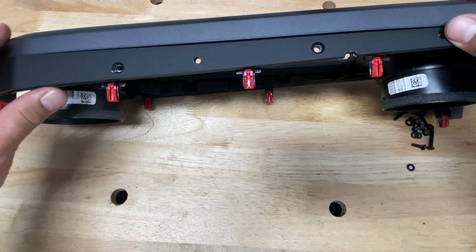Now I'm going to lay my wire on top so I can go ahead and plug that into my USB. Now it's time to slide your bezel, and remember that notch that we reamed out for this radio bezel? Now that wire is going to fit right in there ever so perfectly. Now I'm just going to make sure that my holes are lining up with the brackets that were just installed.